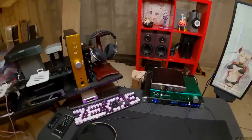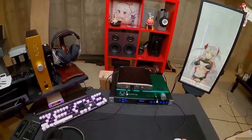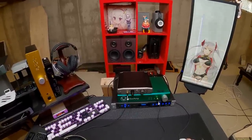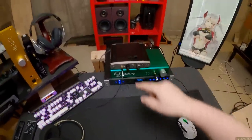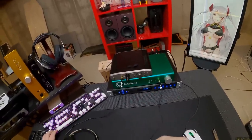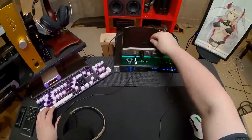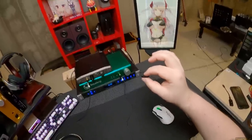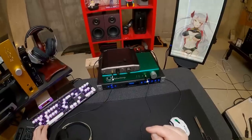I wonder how I could adjust that. My best bet's probably going to be... Oh, you know what? Maybe not, because this now officially makes this mod irreversible. But I've noticed with this pair that I've been using for days, that I just want a tiny baby bit more treble. And I've got it. That did it, because you're taking away 4 millimeters of foam from in front of the driver, and you're now directly accessing that driver with your ear hole. And it's absolutely fixed the treble as far as getting it to you.